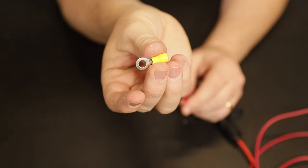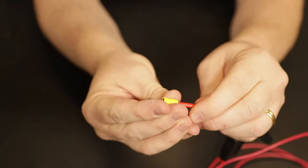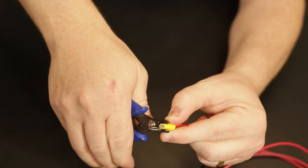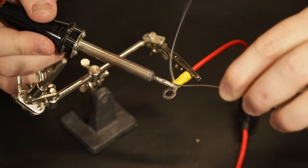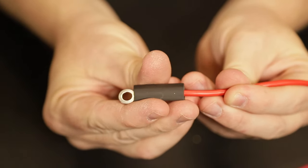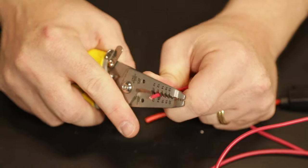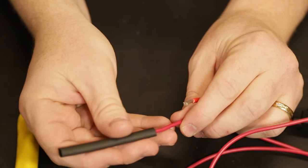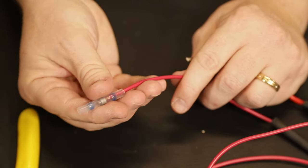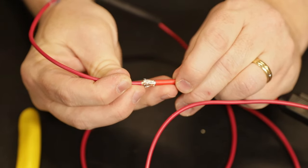I'm not going to get into a ton of detail about how to solder, but I'll just kind of breeze over what I'm doing here. This connection is going to go onto the battery and I'm using a ring connector that slides over the end of a little bit of stripped wire. Once it's slid over I'll crimp that down and then solder the crimped area for extra security. Then I'm going to put a little bit of heat shrink around the very end of that ring connector because this is the positive side and you don't want that to touch anything in the car that might be a ground. Then I need to solder the other end — on the other side of the fuse — to the primary wire that's going to run all the way to the back of the truck.